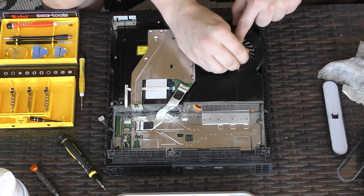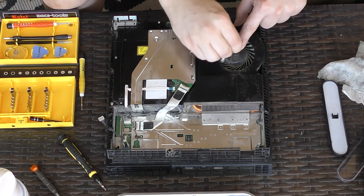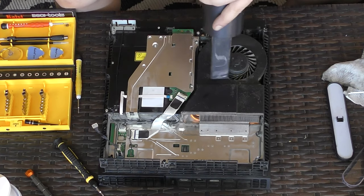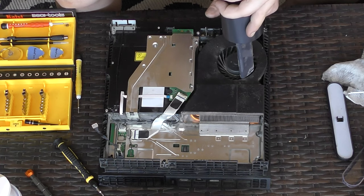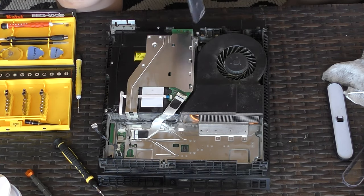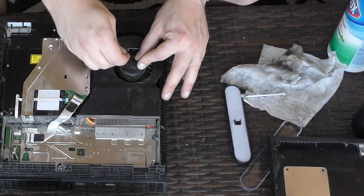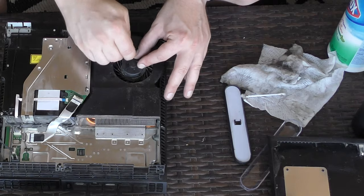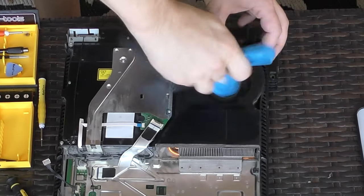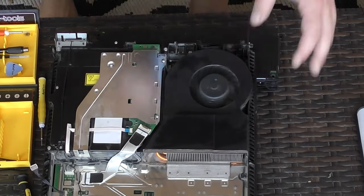For the fan you can use a combination of methods — whatever you have handy. Q-tips: dry them first to break the dirt loose, then you can dip them in alcohol for deeper and more detailed cleaning. If you have a brush, that also helps — even an old toothbrush can do the trick. Those combined with compressed air or a small vacuum will work fine. Make sure to wipe down the whole area, and if you have a brush that can reach into different crevices make sure to hit them up. Since you already have it all exposed, you might as well do it.